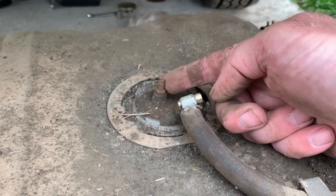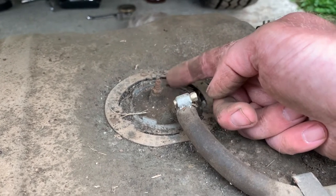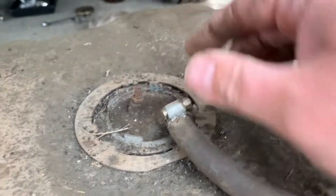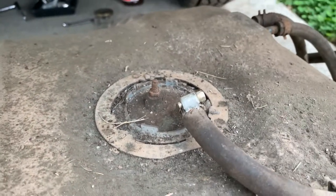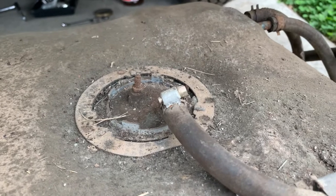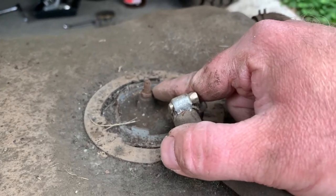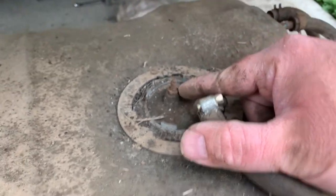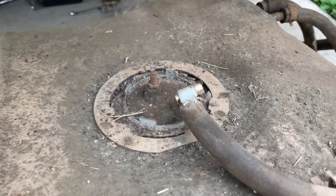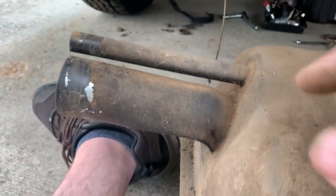This is where the fuel sending unit goes for the fuel gauge — and that's this little wire here. Mine wasn't really hooked up, it was just sitting there. Something to keep in mind if you're pulling this down by yourself without a jack: it's going to be bolted down, so don't just let it fall — it will rip that loose. Mine's hanging pretty low with a lot of slack, so it probably would have been okay, but who knows.